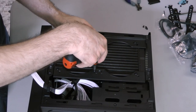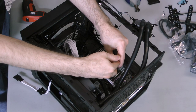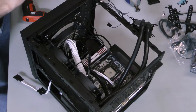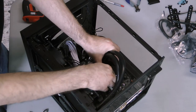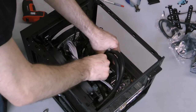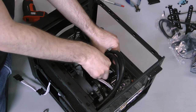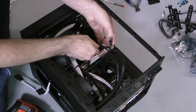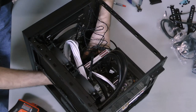Affix the radiator to the frame using eight shorter screws. If your H100i doesn't have thermal material pre-applied, put a dot of thermal paste about the size of a pea onto the center of the CPU. Then slide the water block with the appropriate mounting bracket onto the four mounting posts and use the included screw caps to secure it. Make sure the pressure is even by alternating corners with the screw caps, similar to the way you would loosen or tighten the lug nuts on a tire. After that, connect the water block's fan header to the motherboard's CPU fan header, the two fan inputs from the water block to the fans on the radiator, and finally the power lead to the same cable used to power the SSD.